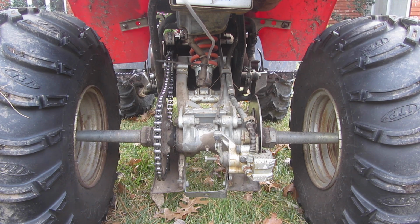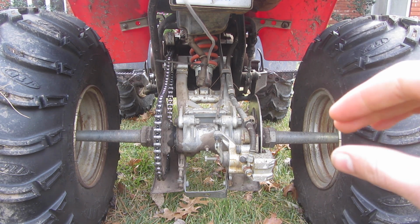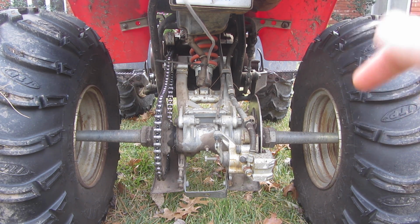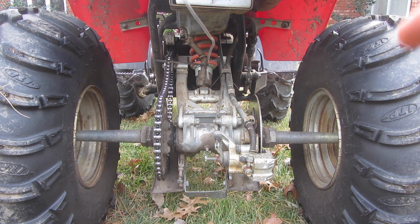Okay, so the suspension on this thing in the rear, it's got a solid axle with hydraulic disc brake, and then the sprocket on that side. And then it's got the swing arm with a single spring. Now the spring's cool. You can adjust the preload, and I don't know if there's a dampening adjustment. I don't think there is. And then also the spring, you can see this better on the front shock. It is a nice spring at the bottom, but as it gets close to the top, it's much more stiffly wound. So that way you have nice, comfortable suspension travel at the bottom. But if you were to go over a big bump or a jump, you wouldn't bottom out your suspension.